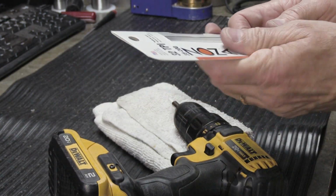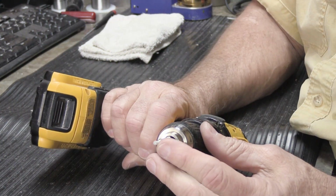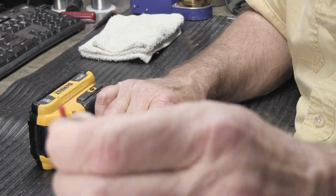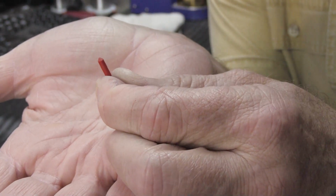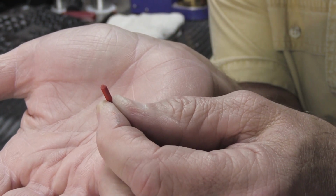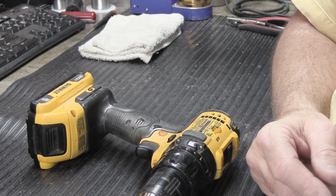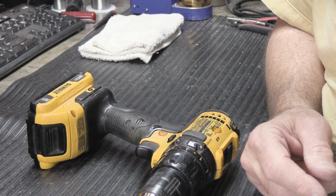We'll put the saw back in the holder. Now we have one more thing we have to do. Right now, since we sawed off the end of the rod, it's just a flat square cut. It has a blunt end. And if you look at the original tip, which maybe you can see, it's got a semi-pointy tip on it. It's not super sharp, but it's not flat either. It is a tip because the reason that it would be pointed is you want to focus the force of the strike to a single point on the tip as much as you possibly can.